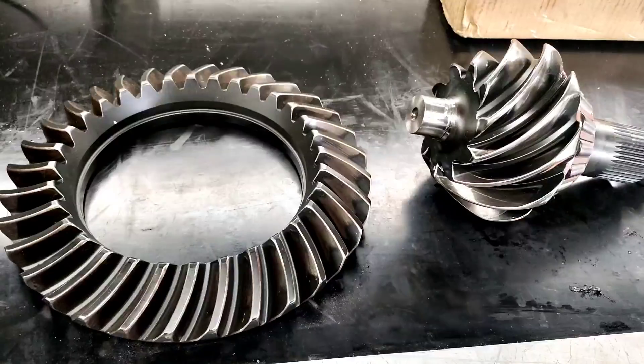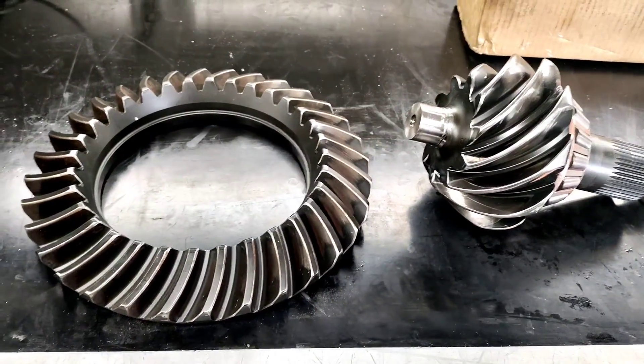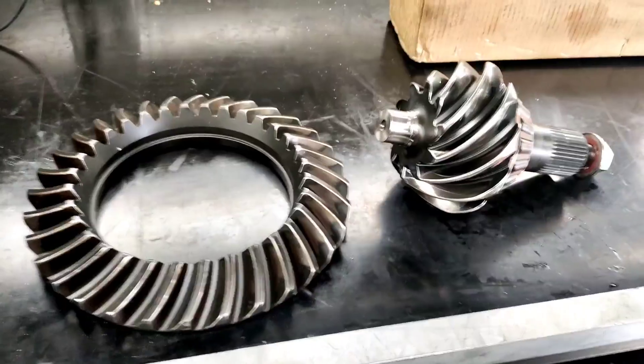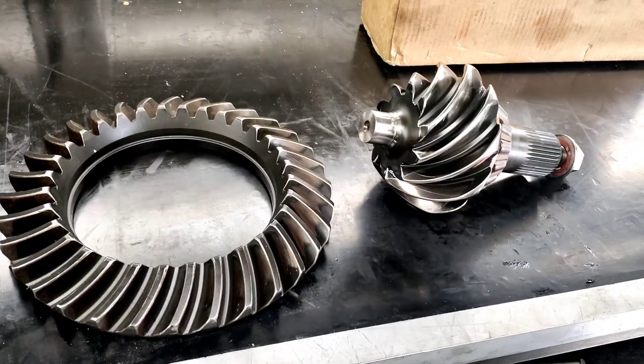Their cycle life is targeted around 50 passes. It's always getting inspected, but we'd like to see them live for about 50 passes, and then they'll have cracks in the ring gear to the point where we can't run them anymore. So I'm hoping that answers everybody's question.